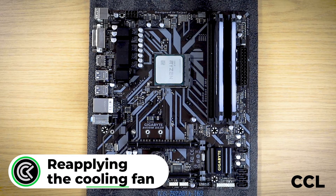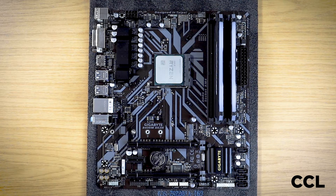Having reseated our CPU, we now need to reapply some thermal paste before we put the cooler back on. Personally speaking, I prefer to use MX4, but it's whatever you can get your hands on. Obviously you won't get thermal paste with your computer, so there'll be a link to a product in the description below the video if you do need to purchase some.